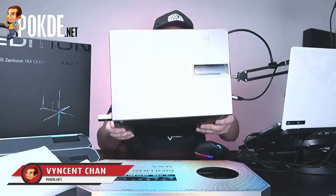Unlike the other laptops which are military standard rated, those laptops can withstand high temperatures, but that is for when the laptop is not operational. So when it's off, they can withstand those temperatures without not being able to boot the next time. This one, you can use at negative 24, which is below freezing and definitely way too cold for anyone to stand outside and use a laptop. And also at 61 degrees, which is also way too hot for anyone to stand outside and use a laptop. So before the laptop dies, when you use it, you will die first. So this is a laptop to get if you are always living in extreme situations. And also it can withstand the vibrations. Obviously, without a hard disk, I guess most laptops should be able to withstand vibrations a lot better, but this one is actually built to meet those standards, 20 to 2000 Hertz vibrations when it's working. So it's definitely not dying.